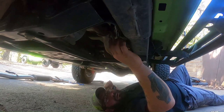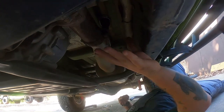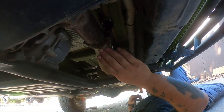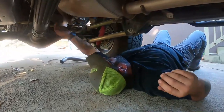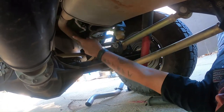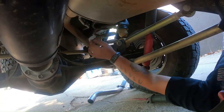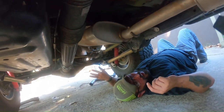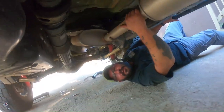We're going to crawl under here and show you where everything is, then set you up on time lapse as we rip it out. Right here's the joint you're going to disconnect — this is your furthest forward point where you'll start attaching the new exhaust, and you'll reuse this clamp. Then we come all the way back after the muffler, and just before it crosses over the axle we're going to take the reciprocating saw and cut it off clean, then it'll drop out. We'll set you up on time lapse for that and come back when we're ready to reinstall.